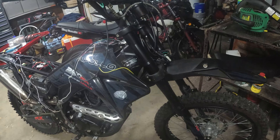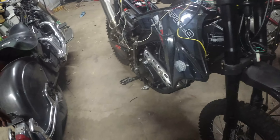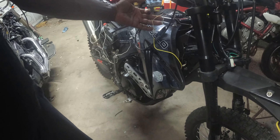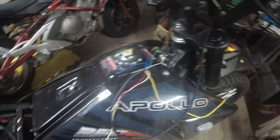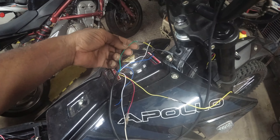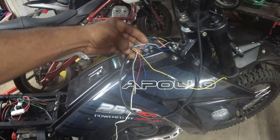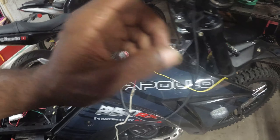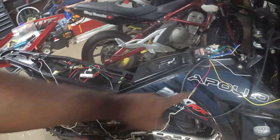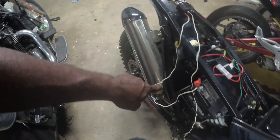Okay, time for a progress update. Look right here — yellow wire going to the yellow on the switch. On the other side we got the yellow wire going to the green. Yellow is the right signal and green is the left. The blues and whites are horn, and I'm gonna use one for light also. The red is your main power — I run it from here down back to my two-pin flasher to the L, and then the other one comes from there to the battery.